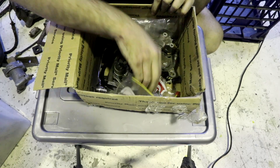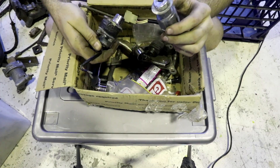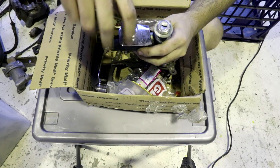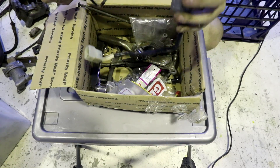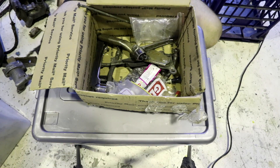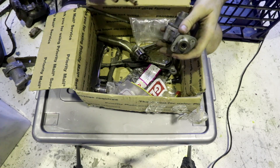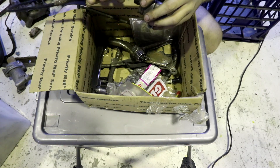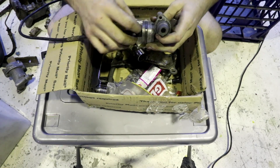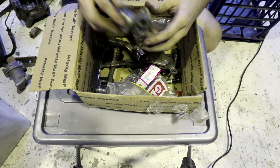These two boxes have been so much more interesting than the two in the last video. I was right — this is the ignition switch. Remember I said that the steering lock — oh there you go, there's another steering lock one. So there's the two of them next to each other. With this car, you've got a start and you've got a lock, and they're separate things. So I'll mark down another steering lock and an ignition switch. That sticks out the top of the rocker cover and I'm pretty sure it's the tacho drive. If one end of the rotating cable that was in this box matches this, we should be able to work out whether this is the tacho or the speedo. Neither end of this wants to fit into that — I'm going to leave these as inconclusive still. I'll put that down as tacho rocker cover drive. Outside door handle — so like the lock and stuff on it. And there's another outside door handle — this one I guess is the passenger one, because it doesn't have a lock in it.